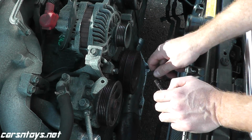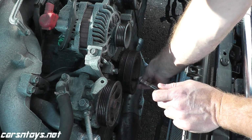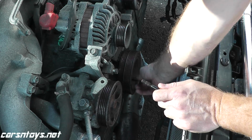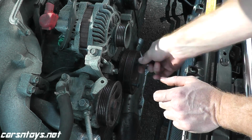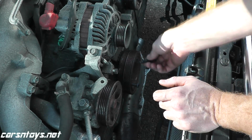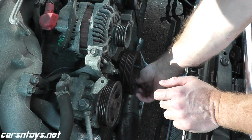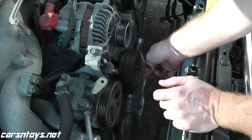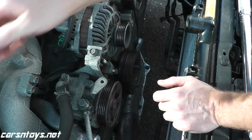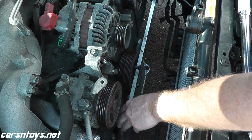I don't have that tool. Another option you can use, you need really, really strong bolts because they will most likely bend at the very least. Okay? Get something at least grade 10. These are 8mm in diameter. And inside the crank pulley, you have 4 holes. They're located at the 12, 3, 6, and 9 o'clock position. And what you need to do, grab yourself a very, in this case, I have a long screwdriver.